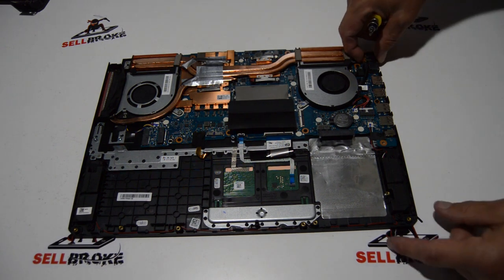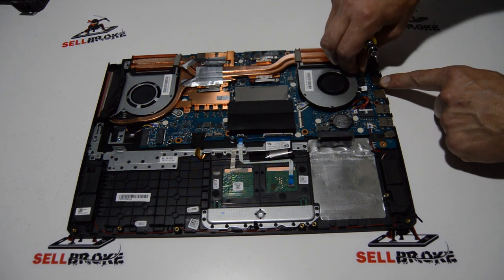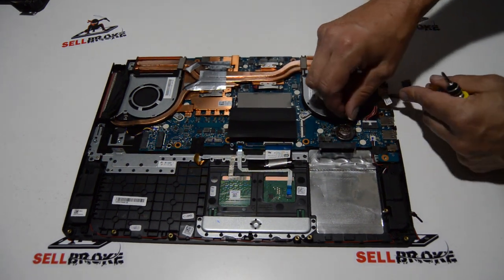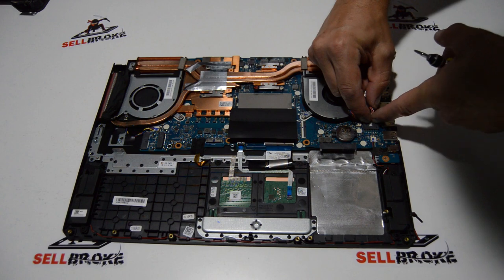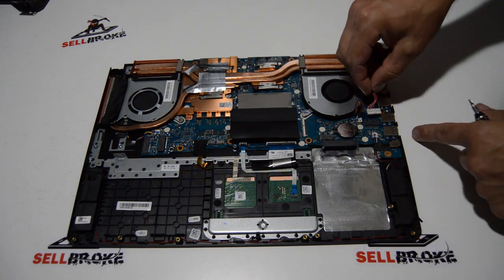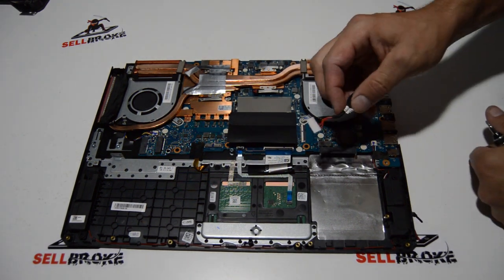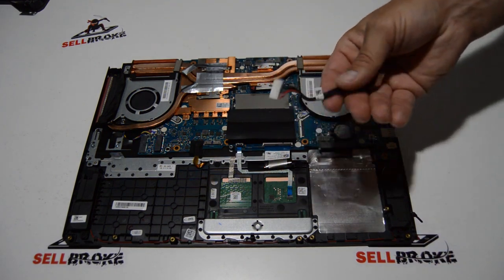Since we've already freed the DC jack by removing the hinge, we'll go ahead and finish detaching it from the motherboard. There's a little bit of tape on that chip. For most types of connectors you don't want to pull on the wires too hard, but DC jacks you can get away with a little more — especially if it's a tough connector to get to. A lot of connectors have tabs where you can get a fingernail on it, but not the DC jack on this one. So if you have to tug on the wire, just be gentle — it can stand up to some pulling.